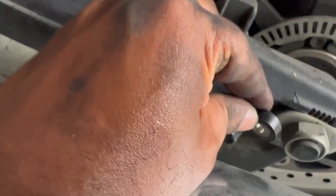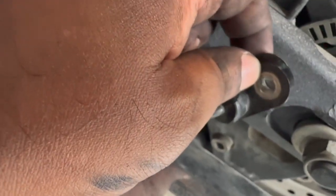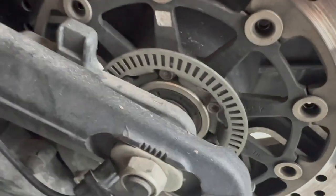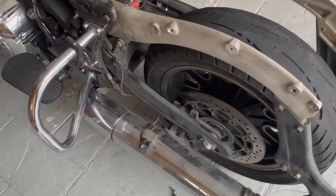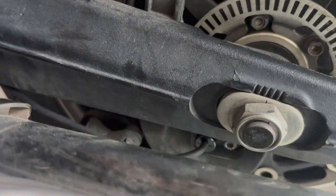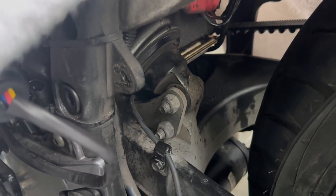This is the sensor — the shim sits here between the sensor and the bracket, and the screw goes through the hole. The shim is what creates the gap, so save it and reuse those shims. New sensor is in, shim reinstalled, bolt back in. I zip tied the sensor wire to the brake line and put the clip back. The connector is reconnected underneath.